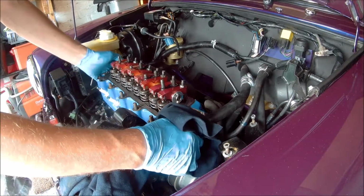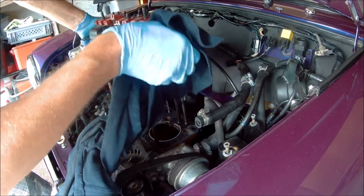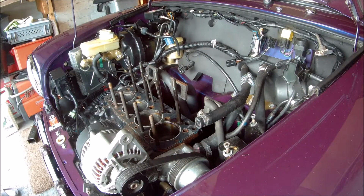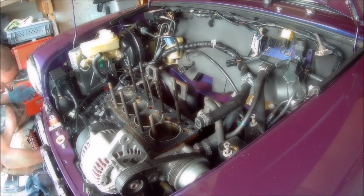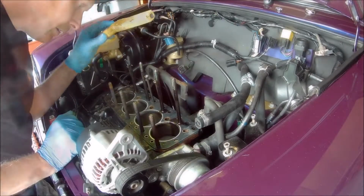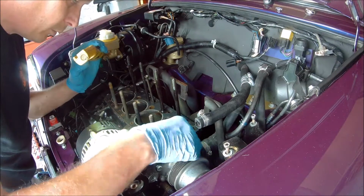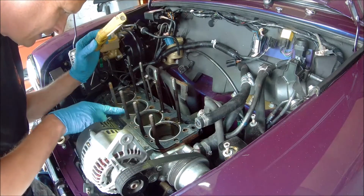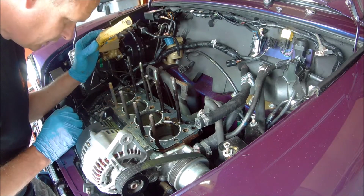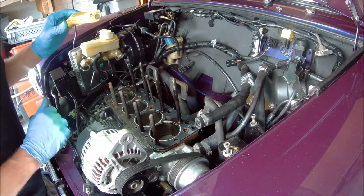Right, kind of moment of truth now. Well, that is not what I was expecting. It don't look bad at all. Well, we'll get it off and have a look first, but looking alright along the front here. Strange. Need to get these push rods out and keep them in the same order. So we put them in a piece of card.